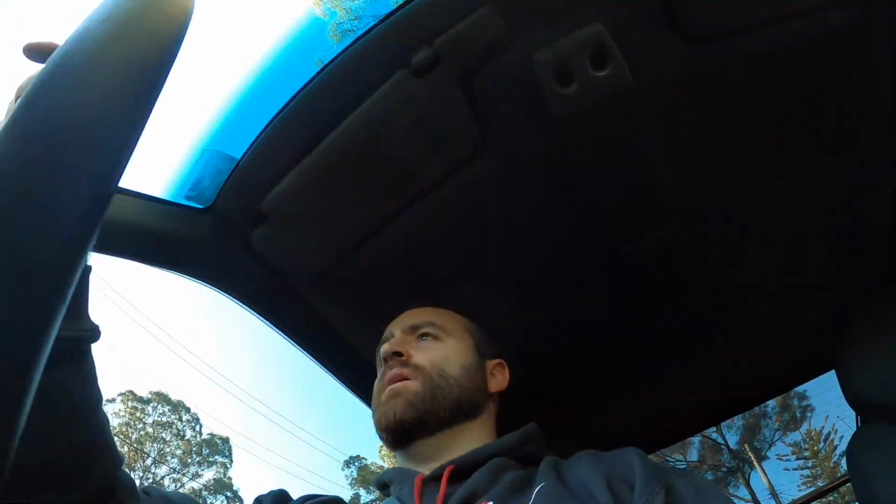So I bedded the brakes in now. They feel real smooth and a lot more bitey than before anyway, like from cold. Before, when my brakes were cold, they wouldn't really brake. You have to really warm them up, but these ones are pretty good. So I'll head home, let the car cool down for 15 minutes. I'll do other few things, and later on I might do the 100k ones somewhere.